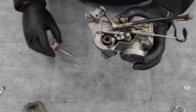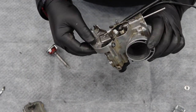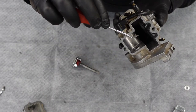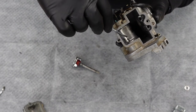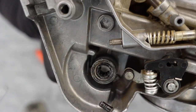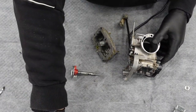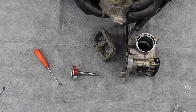Looks like there's actually some bearings that this rides on. You just got to spray it a bunch with some carb cleaner, dissolve the grease in there, and just kind of re-grease it. Look at all that gunk that's been in there - that'll make your throttle feel a little on the sticky side. So now I'm going to take all these pieces, give them a deep clean, and when we come back we'll start our reassembly.